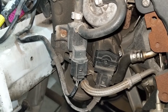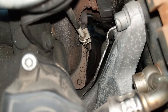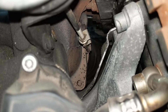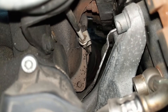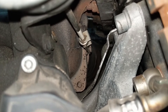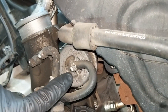To appreciate what the N75 valve does, first you need to understand the relationship between the turbo and the wastegate. The wastegate — and I'm talking about internal wastegates here — is a valve that sits inside of the turbo housing on the exhaust side, where it's either open to siphon away some of the exhaust coming out of the exhaust manifold and send it directly out your exhaust system, or it's closed and that'll make all the exhaust air pass over the turbine in the turbo, continuing to make the compressor build boost.